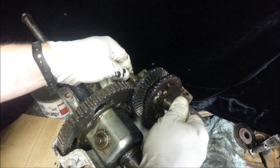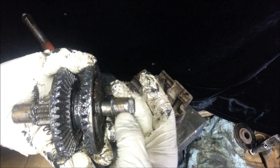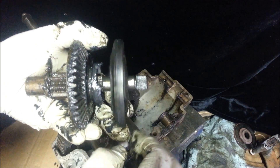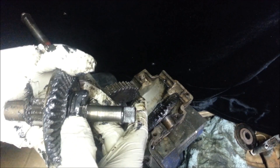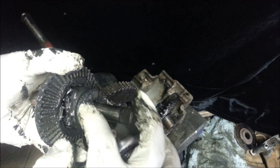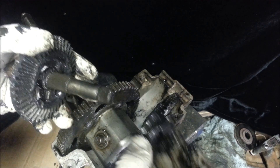And what you've got going on here is this shaft right here. This is just a bearing. This is actually free-floating on here — just spins on there, nothing holds it. Here you have a gear selector, and this is locked to the shaft. And it has teeth dogs on it. This is locked to it with these splines and that spline.